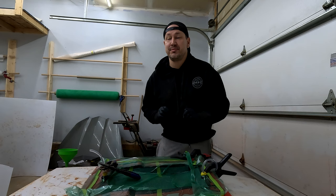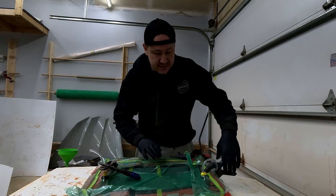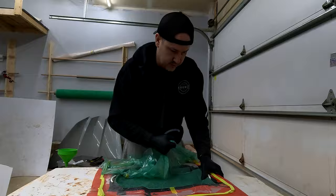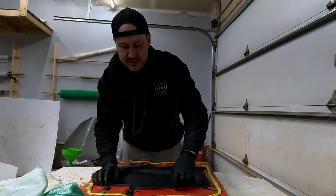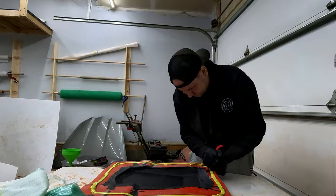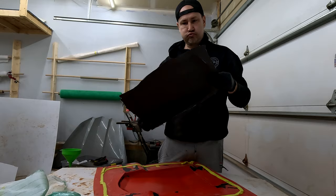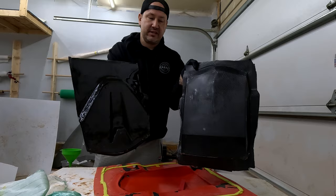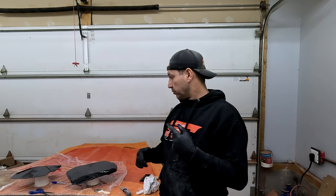Guys, it's a new beautiful day. It is early — 4:30 in the morning. My family's sleeping. I just couldn't contain myself. I'm so excited for how this bag on this thing actually turned out. Look at the clamps off here — isn't that beautiful? Let's get this apart. Look at that PVA off there — you can see it's sort of shiny. You can see the difference with PVA and without PVA. So we'll get it cleaned off and go from there. While this is curing, I think we're going to try and make a fiberglass one too, because a lot of people want to wrap their stuff or paint it whatever color their car is. We'll use the same molds, do a fiberglass version, and finish it with primer. People won't have to pay the big money for carbon fiber.